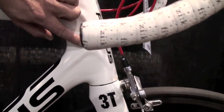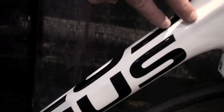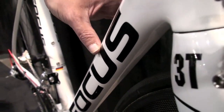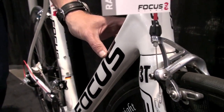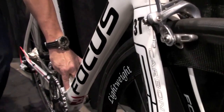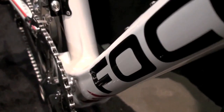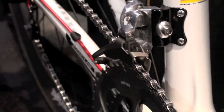The big point is the new internal reinforcing cable tunnel. Cable tunnel means that inside is a Teflon tunnel. It's carbon wrapped and we get better lateral stiffness and we get smooth shifting performance with a long curve here, because we go directly into the rear derailleur. So that's quite new in the market.